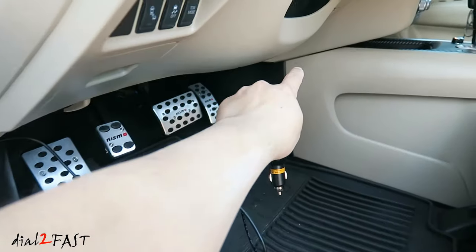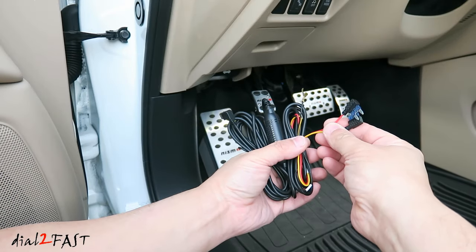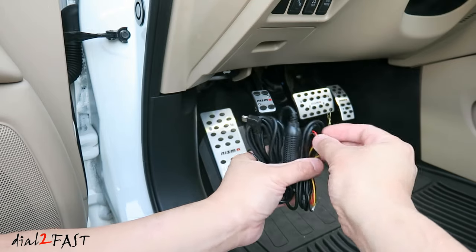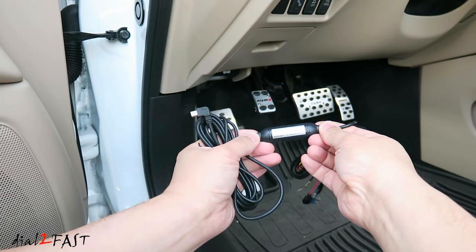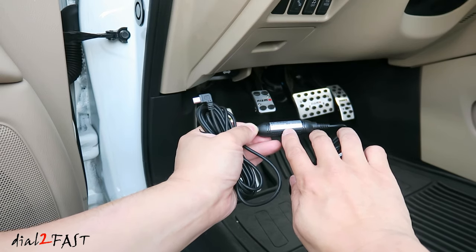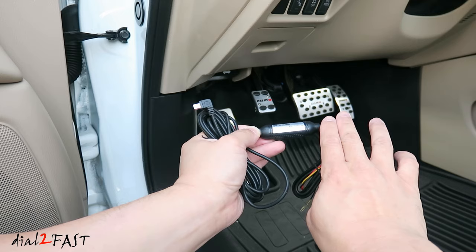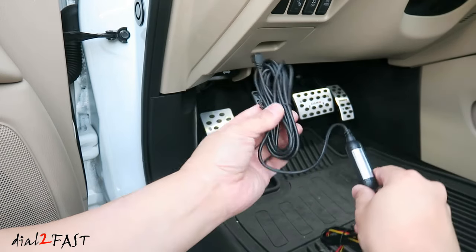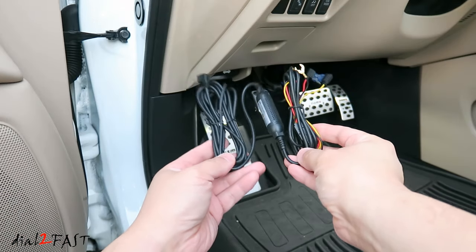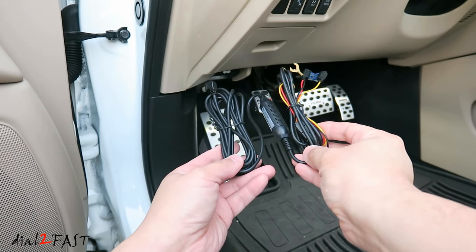Run the power cable underneath the dash over to the center console. Plug the power adapter into your 12-volt accessory port. Now if you want to install the hardware kit, you need to connect the red wire and the yellow wire to the fuse box to get constant 12-volt and ignition 12-volt. You also need to connect the black wire to chassis ground. There's a protection circuit — the input is 12-24 volt DC, the output is 5 volt at 2.5 amp, and the cutoff voltage is 11.6 volt plus or minus 0.2 volts. What this means is if the car battery drops to 11.6 volt, then the output voltage will be cut off to prevent the car battery from draining so low that you can't start it. On the other end, run this cable all the way up to the dashcam and plug the mini USB connector into the power port. I've done many videos on how to install hardware kits in your fuse box, so I'll link a video at the end and include the link in the description below.